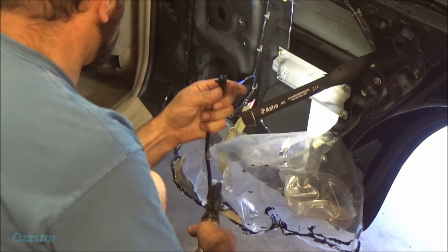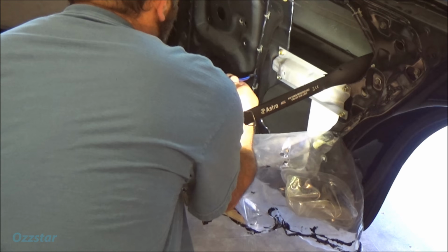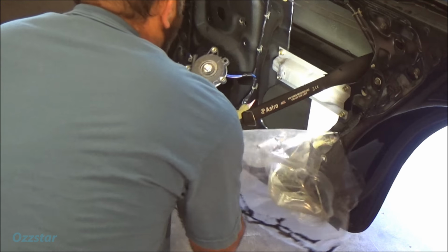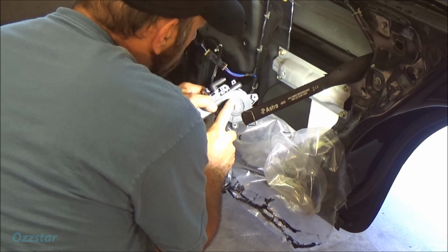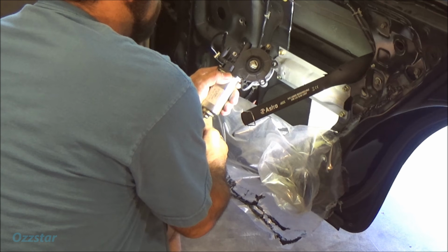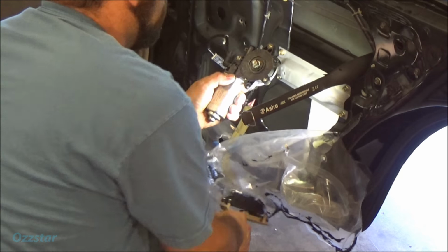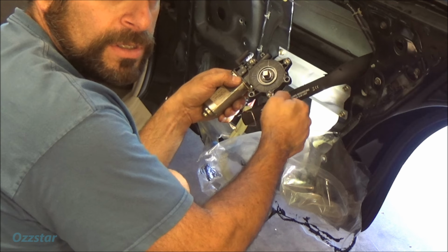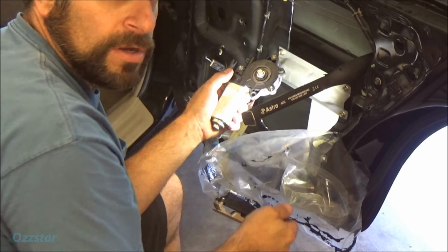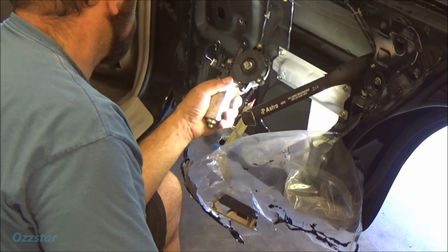So we're back at the car, and I don't have a power probe, so one way to get 12 volts to it is to hook it in there. Now the ignition is on, and I have my alignment marks right here, so I know where this was. And if I hit power now, you see it's moving, and I hear it. Okay, so the only thing we did was take a 10 millimeter and wiggle this 3/8. So something must be hung up in here. There's a dead spot in the motor or something. It's probably best to replace this right now so that it doesn't happen again.